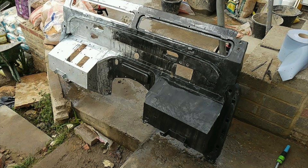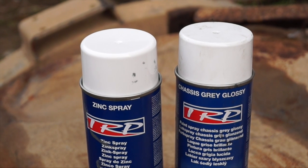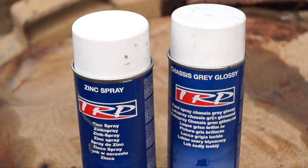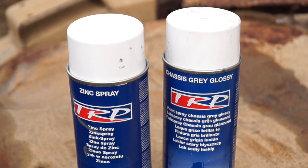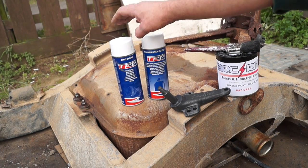However, galvanizing is sacrificial — something to remember. The photo shows the galvanization being treated before it's painted. Zinc primers are often misunderstood; a zinc primer can have a high content of zinc — a spray tin with the most effective content has about 80% zinc and upwards. This has to be painted onto clean metal with no corrosion underneath, then acts as an electrical contact and will decay over time, leaving the metal protected.